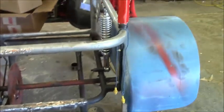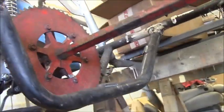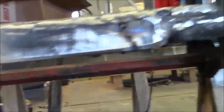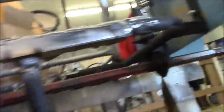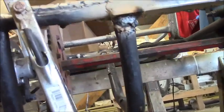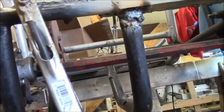So I'm going to get the sawzall and cut this. I'll bring it back when I'm welding it. I did get it welded back in a position where I can put up some little bar strap. Now look at how small this is — it's only 1/8-inch thick and that holds the whole rear axle. I am putting in 1/4-inch thick pieces of bar, only 3 or 4 inches long. For one thing, it's going to guard the chain and sprocket from bumps and logs, and secondly it's got to give me a brace for my center bearing.